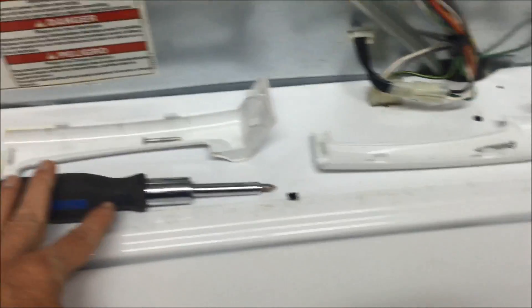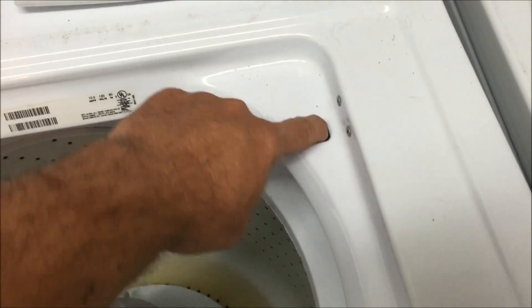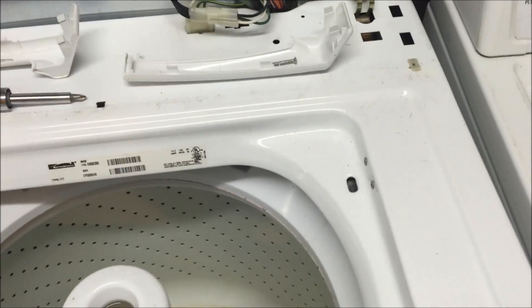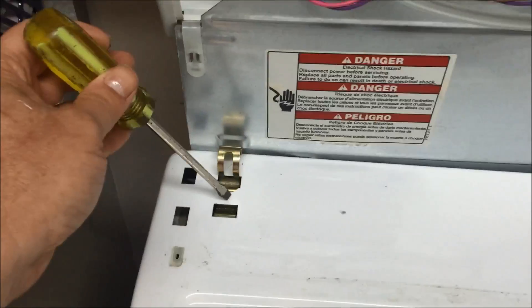The screws are about an inch and a half long — no problem with a screwdriver. What I talked about before is here: there's the plunger that's on the lid. The plunger presses into this hole and knocks the switch back. To test it, just stick a screwdriver in there — if you hear it click, it works; if you don't hear it click, it's broken.